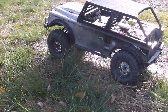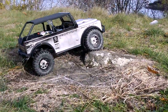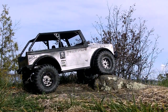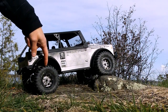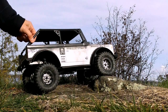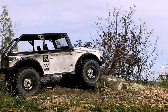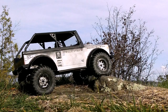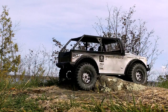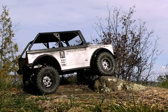Let's have a look at these new tires we've installed with our cut foams. There's our Dingo, and we really like these — we like the way they look on the truck and the way they squish on the rocks. You can see here on the front tire there's just a small little rock, but that makes a big difference with the foams cut. With the cut foam we've got room for the tire to squish on the rocks pretty much just with the weight of the truck. When you get to the rock, the tire conforms right around it so the tire's got maximum bite — really great for performance. I'm really happy with the cut foams and the rip saws. This is going to be great.